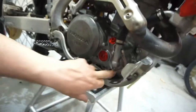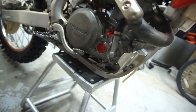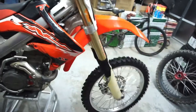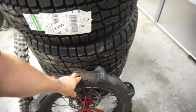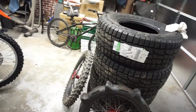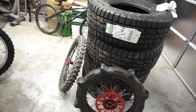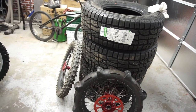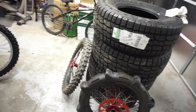I did the water pump — the shaft, the seal, the bearings — everything inside is new. New gasket for the case. Both wheels have heavy-duty tubes. The tire wasn't that bad to put on — took about 30 minutes to take the old tire off and put the new paddle tire on. It went really smooth.